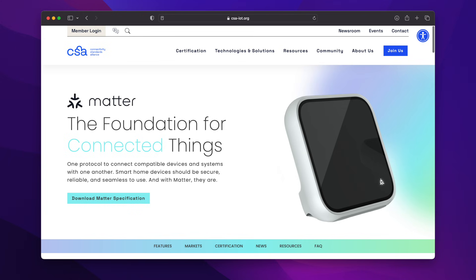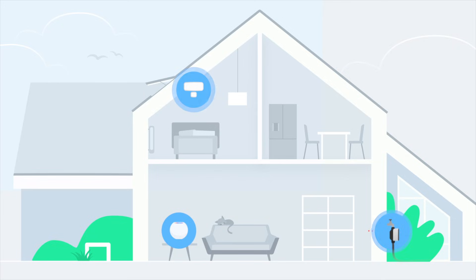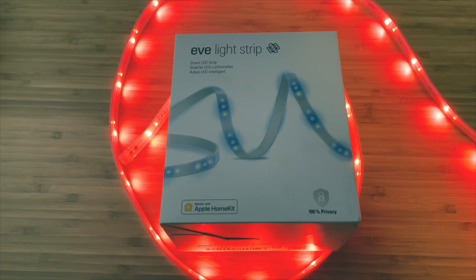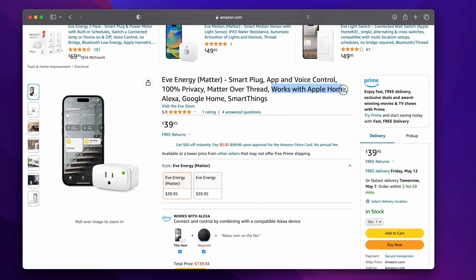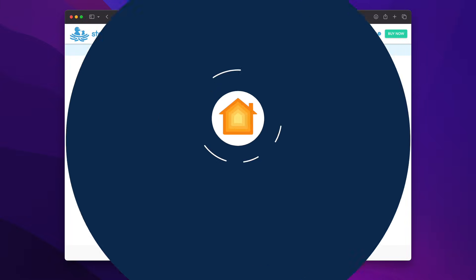And then there is this new smart home standard that you've probably heard of recently: Matter. Matter is not a specific wireless protocol like Wi-Fi or Thread — Matter supports both Wi-Fi and Thread. Without getting too technical, Matter is a language that all smart home devices speak to each other that allows the devices to now work with all smart home platforms, and Thread or Wi-Fi is the mode of how devices communicate that language. Matter devices can still use Wi-Fi or Thread as their primary connection. Some brands already make smart devices that work with all platforms, like Meross or Philips Hue. But some brands only made devices that worked with a specific platform, like Eve just worked with Apple HomeKit. But now with Matter, devices can work with all platforms right out of the box, meaning you could buy an Eve smart plug and use it in the Amazon or Google ecosystem. And devices that did not support HomeKit before, like the Google Nest thermostat and smart speaker, now can work with HomeKit.